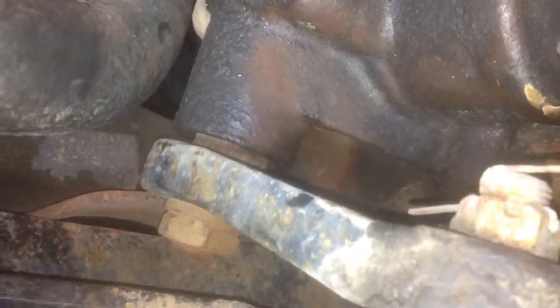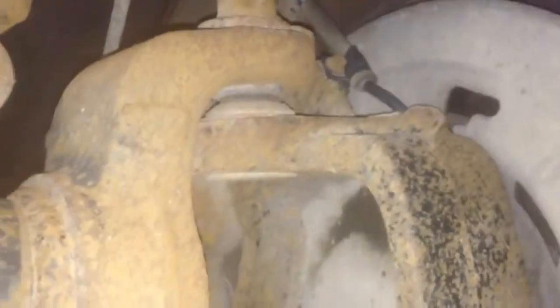We're going to go for a gearbox. This is a 2003 F550 two-wheel drive. It's got both upper ball joints with all kinds of play in them. The passenger lower ball joint has play in it — that one's pretty tight right there, but he's probably going to want to replace them all when we're in there. The inner tie rod going right on the pitman arm is also a concern.